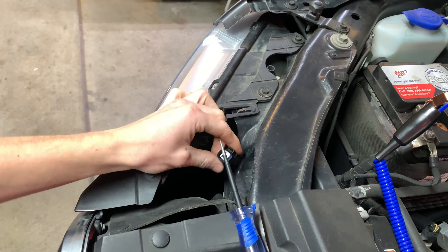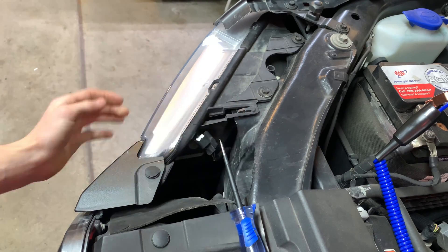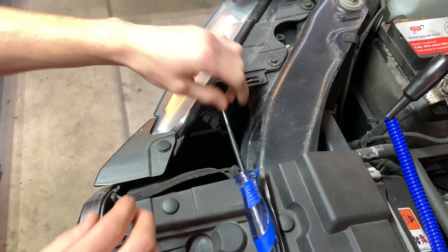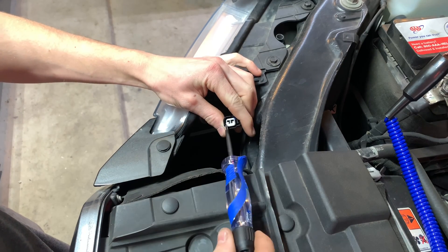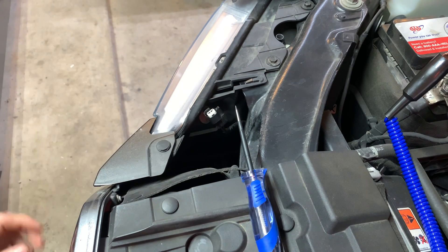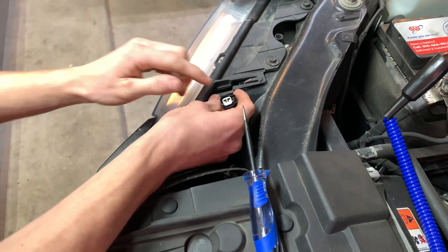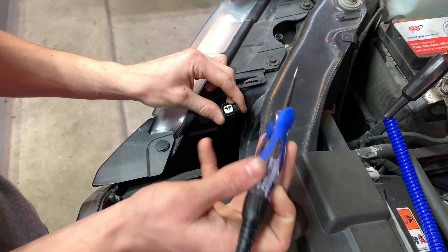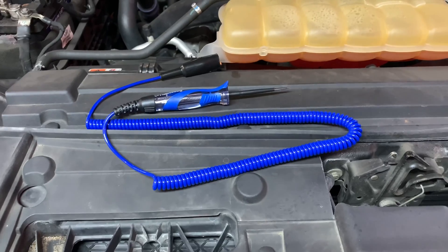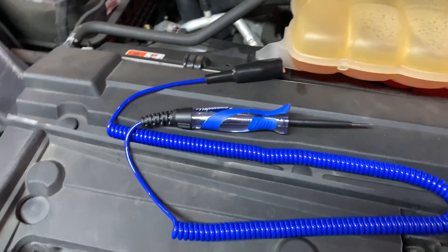For the last test, I'm going to be testing for power at this connector — this is for the little parking light, that orange one in there. The light is off right now, so there should be no power at either of these pins. Right there — not lighting up, and that one's not either. Now I'll turn the light switch on so you can see it's getting power. Now that the light switch is on, one of these should be hot — it's not that one, so we'll move over to this one, and as you can see it's lighting up.